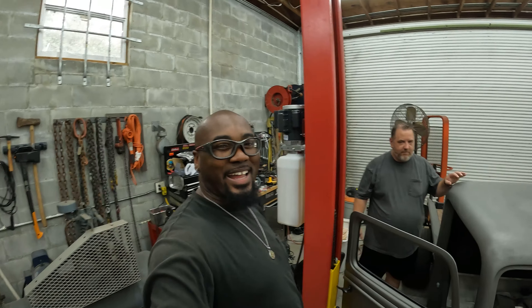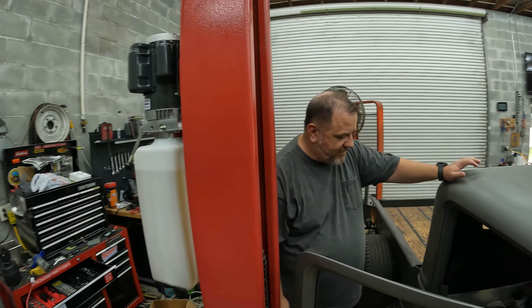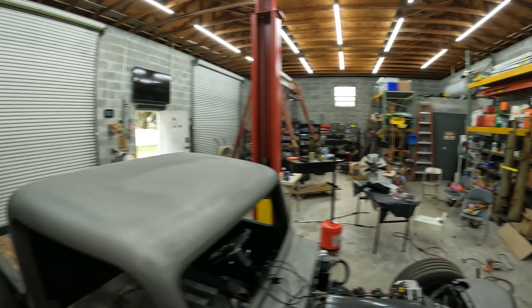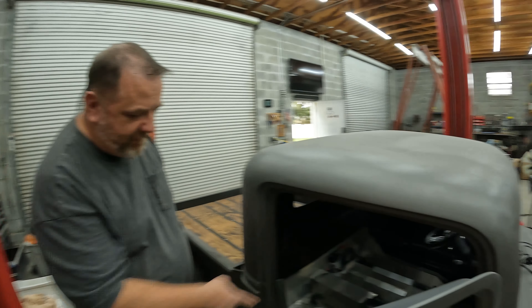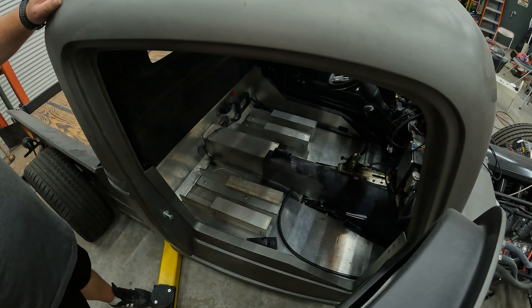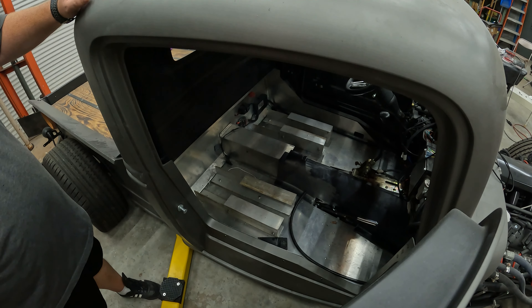Welcome back guys. Brian, tell me what got done while I was at work. Well, I finished sanding the driver's half of the tunnel - that side is ready to go. Then I had to come over and put the passenger side in and make the cuts to go around the freshly installed parking brake handle. Had to cut quite a bit out there to get it to drop in.